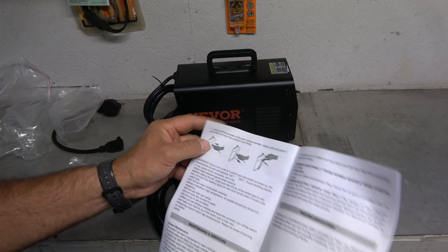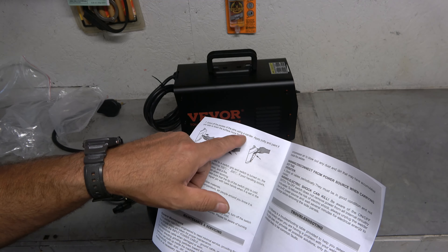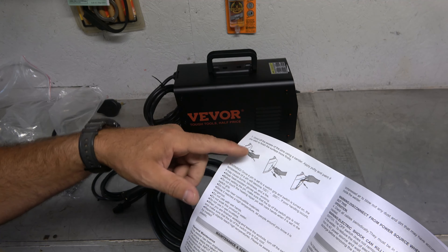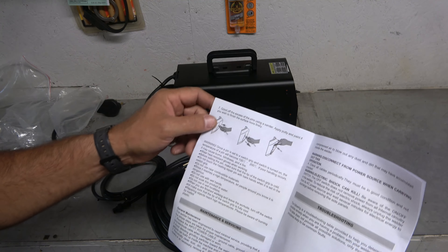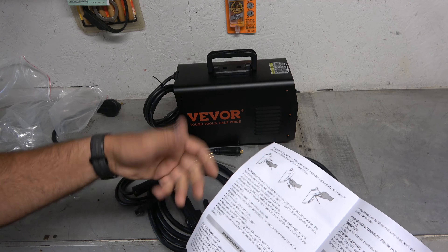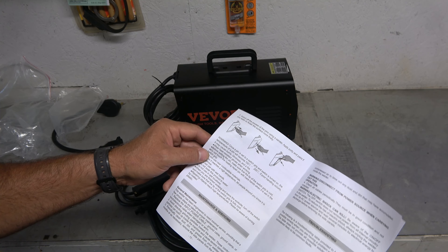Although I don't have anything to staple today — that's the part I'm most interested in playing with down the road. As you heat it up, you put it in your stitching, and then you can grind it off using a sander, or paint if you want a more even surface. Melt it in, cut it flush, sand it a little bit, maybe use some body filler if you need to, then paint over it — that's about as good a repair as you're going to get. Pretty cool.